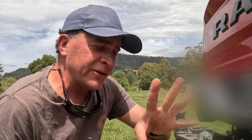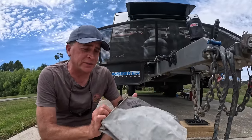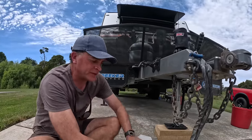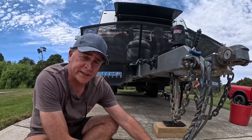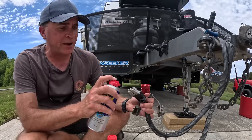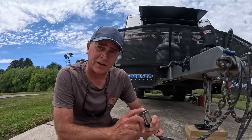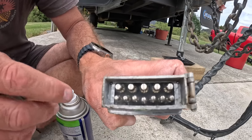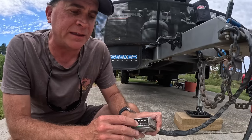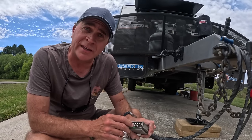On the caravan it's pretty similar, but there are a couple of other things you might need to consider. At the front of the caravan it's the same procedure, but the first thing we always do is make sure our contact points are covered. We've got one of these navigator bags — basically you put the plugs in there while you're stationary. Our plugs are pretty dirty; I haven't cleaned these now for about a month. The only difference is with the 12-pin plug on the caravan — sometimes these pins can actually get compressed to a point where they're not working properly. You get a little razor blade, insert it between those two points, and just prise it open a little bit. If you've got a brake light or hazard light on the back of the car that's not working, 99 times out of 100 it's caused by these pins being too compressed.